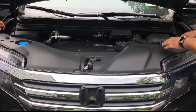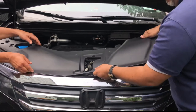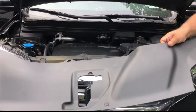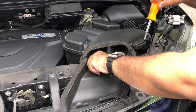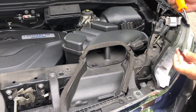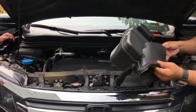To begin the installation, pop open the hood and begin to remove the plastic cover. It's easy to remove — just pull it up and the clips will disengage. Then with a screwdriver, you will need to unscrew the air box bolts to remove it. After you unscrew it, just pull it out and put it to the side.